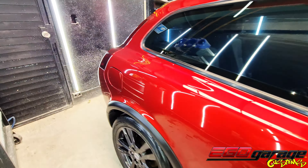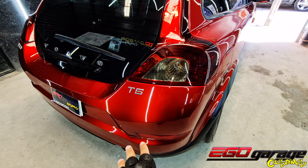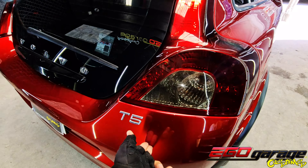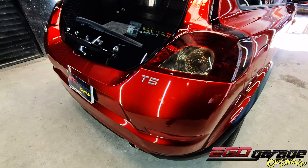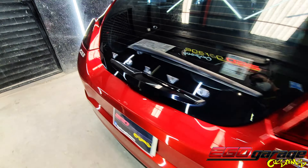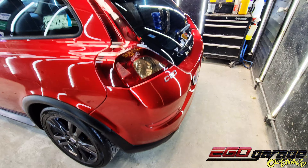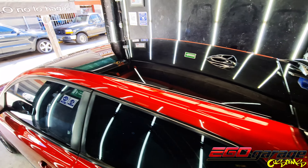There are no more scratches — they are all gone now. The bumper bases — look at the condition they were in in that photo, very bad shape. You don't apply filler to a base because it loses flexibility. So here you can notice the quality we achieved, the perfect fitment of the fascias, their perfect adjustment, and the plastic restoration. This work turned out really, really good.